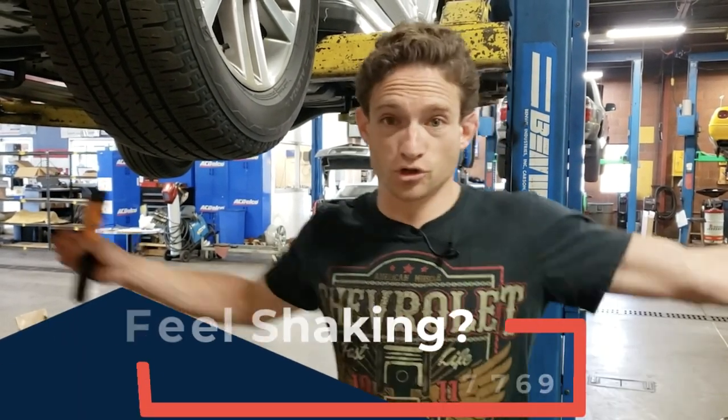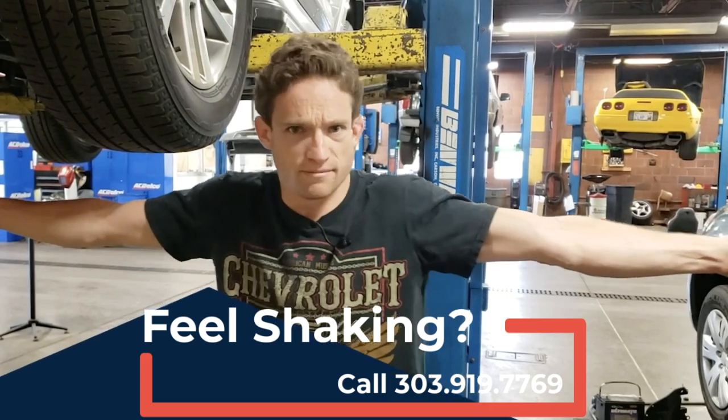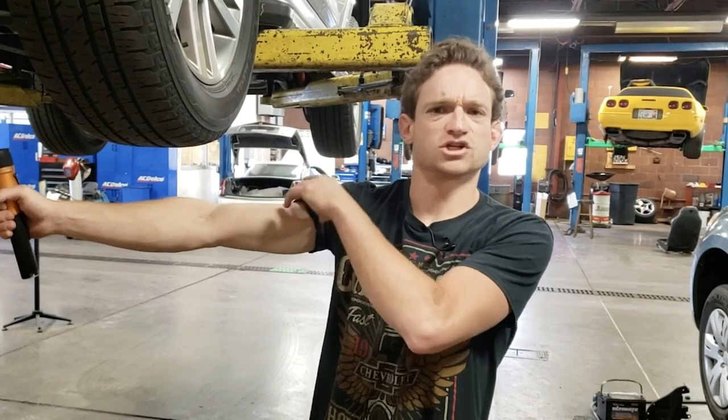Another effect is on the steering. Most pickups and SUVs are designed with small, lightweight steering components so they feel like a car rather than a truck. The detriment is that just like those calipers sliding back and forth, the front end shaking from warped rotors also affects the rack and pinion — the steering gear that pushes side to side. It will physically push and oscillate, and where the tie rods come out of the rack, the actual seals begin to break down, lose their continuity, and eventually leak fluid. Just like a body has blood that's never supposed to leave, the rack and pinion has fluid inside that should never escape — but shake it hard enough and something will leak.